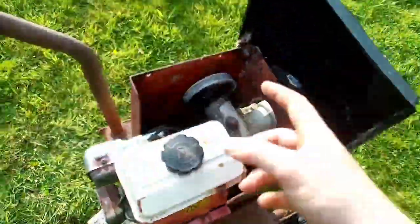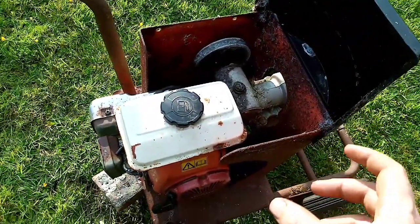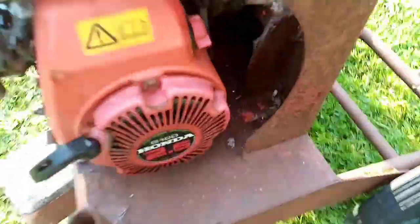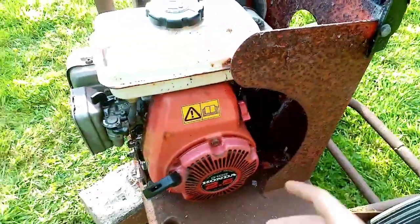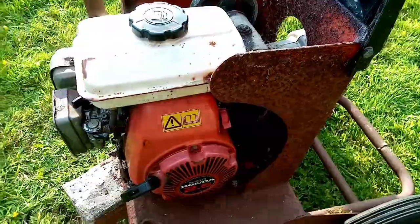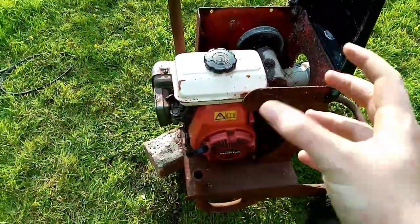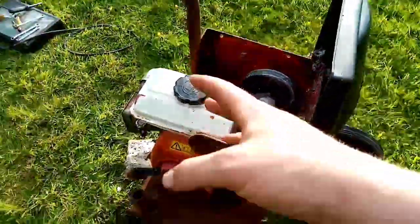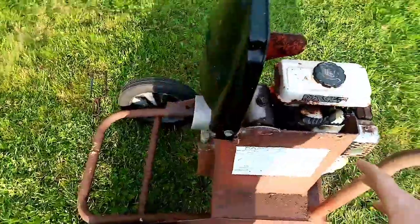Always hold on to the old belts and put a bit of a label on them so you know which one they are, then you can go and get them made or make sure you get the right size. There are little adjustment bolts on the mountings — this can be slid forward or slid back for the tension. Over time the belt wears and expands, that's why it goes full length and becomes useless. It's a great little engine — all it needed was a good clean out of the carburettor.